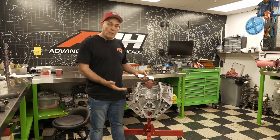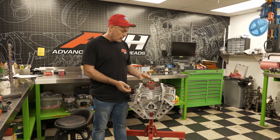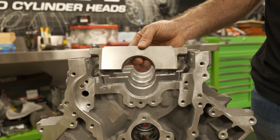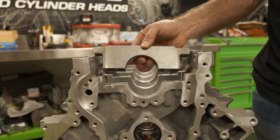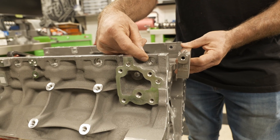Here's another configuration — this is a late model LS engine, and what you see here is a lot of what you'd see in a Coyote. You have a 4-bolt cap that has side bolts, so it is not only a deep skirt block but the block has cross bolts that come in through the sides and help stabilize the main cap.